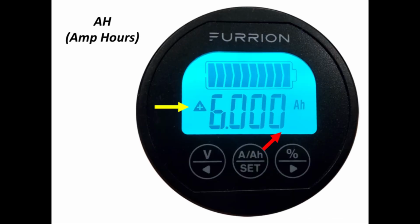On this slide, you can see the little arrow pointing up with the plus symbol. Of course, as we learned in the last slide, this means that power is flowing into the battery or the battery is being charged. But the main point of this slide is to talk about amp hours. The maximum amp hours displayed are entered by you, the operator, during the calibration process. If the entry by the operator is wrong, this display and the percentage display as well will be inaccurate. And also note that the tiny 6 amp hours shown on this slide is because of the small motorcycle battery that I'm using in the demonstrator. Typical RV batteries have 100 amp hours and even more.